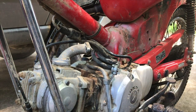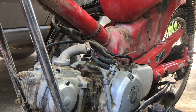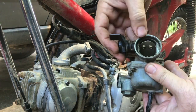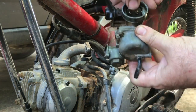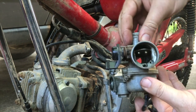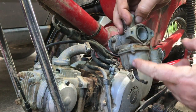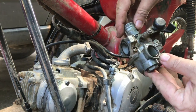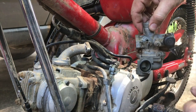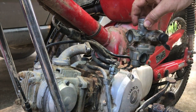A little bit of fuel, which is good — it means fuel's getting in there. It's really gummed up inside. That's the old choke flap — it's really gummed and dirty, you can see it's a mess in there. Later on I'm going to have a look in the fuel bowl to see what issues it might have been. But for now I just want to get the new one on, which looks a lot cleaner than this. So it'll just be the reverse process — I'll put it together and show you what it looks like when it's on.